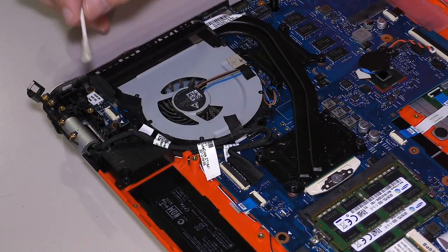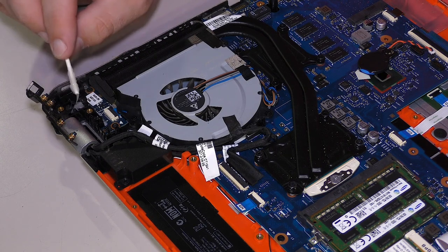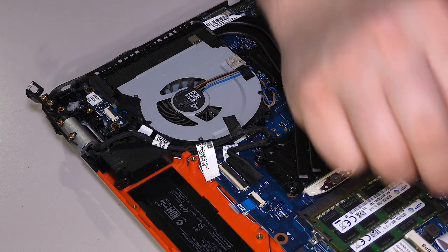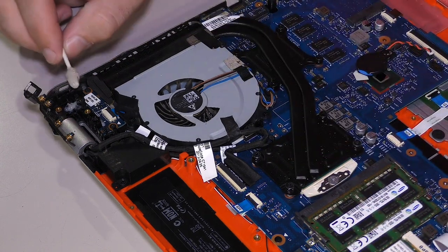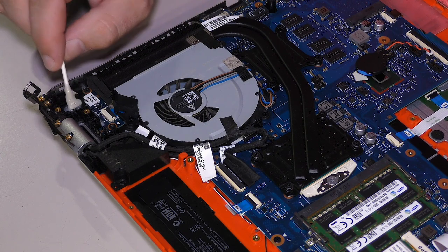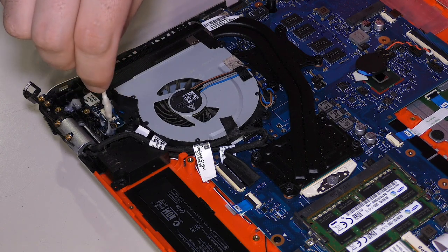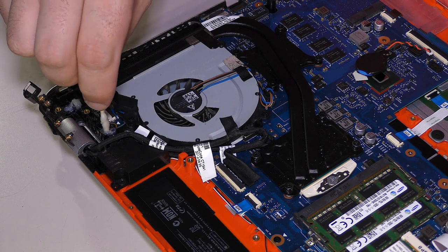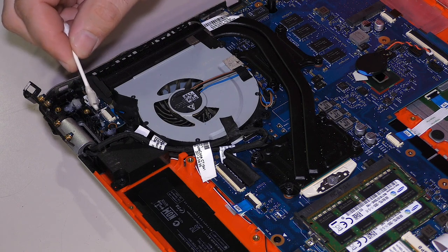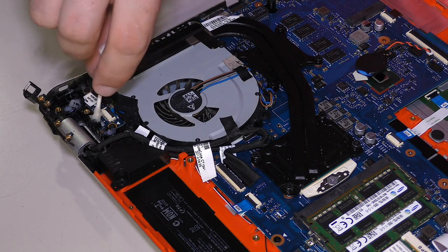So under the hinge here, these areas are where the anchors go and the screws, and I'm basically just permanently gluing it together. Because we've had basically all the anchors rip out, this whole area is clearly not really designed well enough to accommodate the forces of the hinges as they age. So we're going to have to tighten it up a little bit. There we go. Get a bunch of epoxy down in the holes there. Chunks of plastic are coming back up. That's always fun. All right.